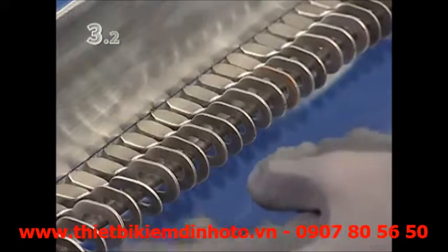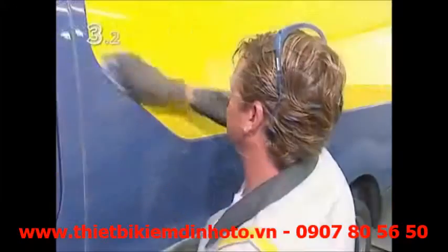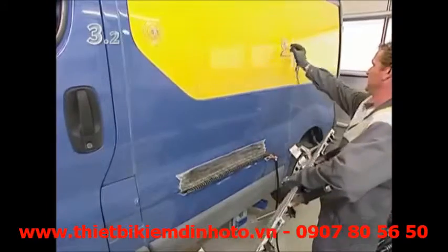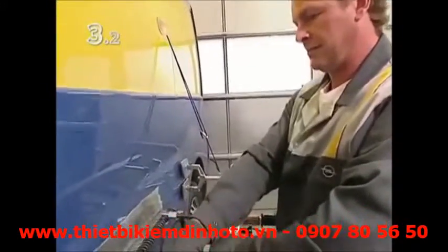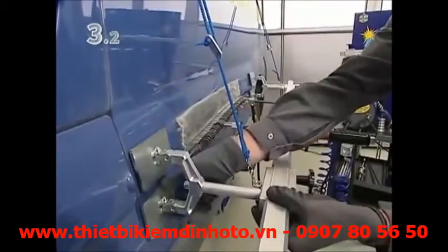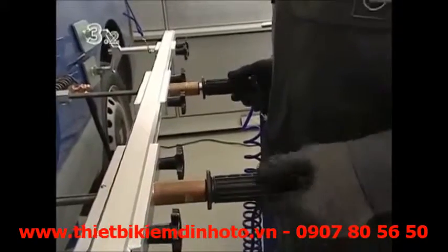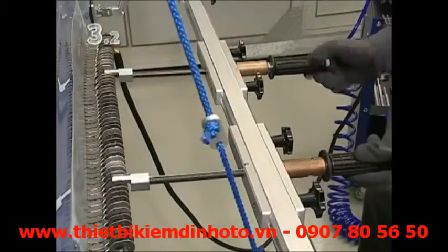Insert a pulling bar through the openings of the pulling eyes. As the long pulling bridge is used for large damaged areas, suckers are applied to hold the retaining straps of the pulling bridge — this allows the pulling bridge to be handled by just one person. Use the retaining straps to position the pulling bridge at the correct height and adjust the supports to fit the shape of the body. Set the hooks to the optimum pulling points and adjust the puller. With the Flatliner system, up to two pullers can be mounted simultaneously on a pulling bridge.